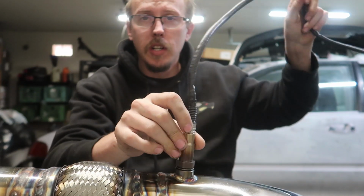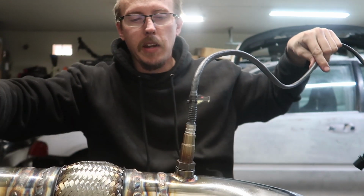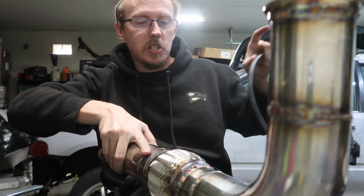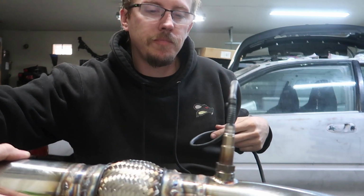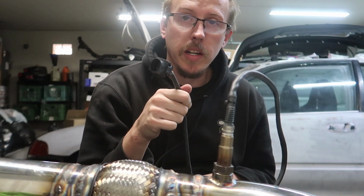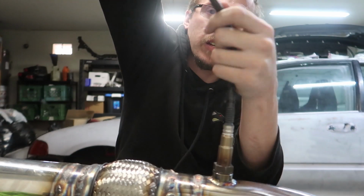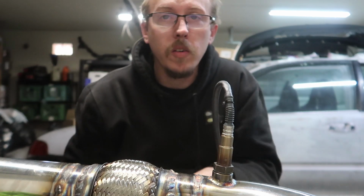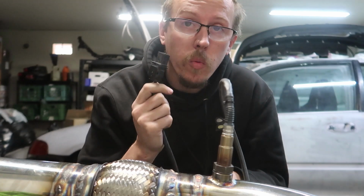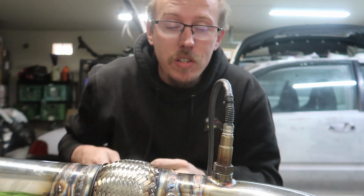So now we got our actual O2 sensor for the wideband. This is the wideband. And now it's in, just a smidge upward from horizontal, so this should work just fine. Then we can plug it into the sensor and finish the wiring up for that, because it goes up the firewall sort of deal. From there, we can give power to everything, and then we should be able to get a reading while the engine's running. So let's get to seeing how bad our AFRs are.